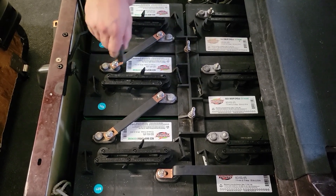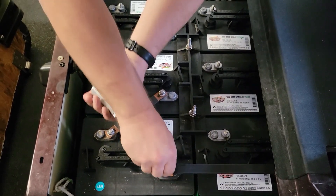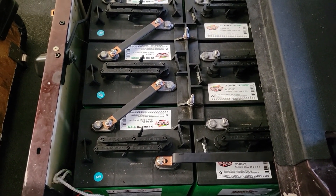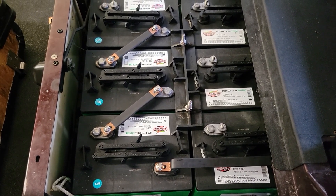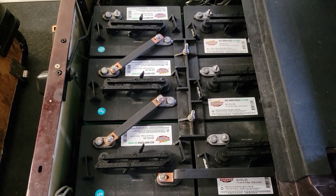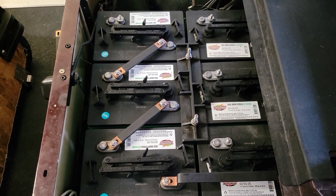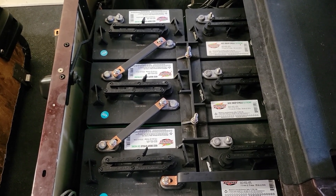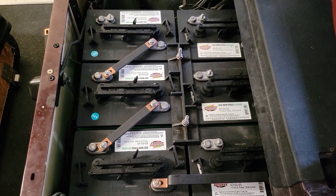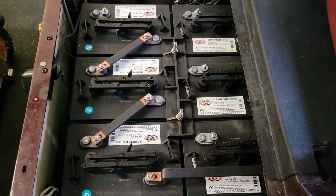And these are much easier to clean. We did a little sampling with six-gauge versus four-gauge versus bus bar. We cut off an inch of each one of these pieces of material, and we came out with four grams for the smallest wire, six grams for the upgrade wire, and 13 grams of weight for one inch of bus bar. So it's going to move the power through these batteries at a much more efficient rate, and we're not going to have corrosion going up inside the wiring — that's where we see our biggest problem: corroded wires internally, which creates hot spots.